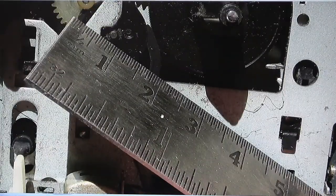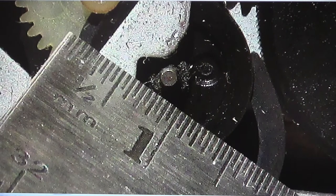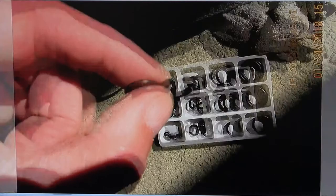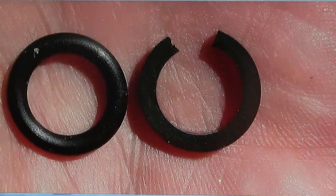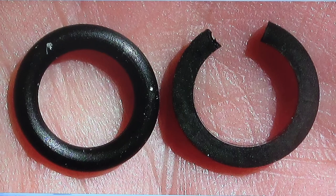The tire breaks, the take-up reel doesn't spin and eats your tape — and you wonder why, that's why. Here I'm trying to measure it and I got approximately 14 millimeters — 14 millimeters is the diameter needed for a tire. I found one. I tried an o-ring, I'll show you that in a minute. Here's an o-ring and there is the original tire, broken. The o-ring worked, but I eventually found one last remaining thin tire that would fit.